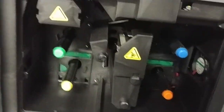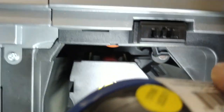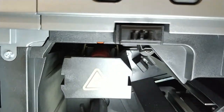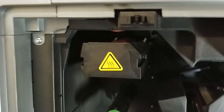Lastly, we're going to open up the printer, remove the ribbon and the film, and then look up inside here. You can see the orange roller up top — that's the card path. The heated roller down lower raises up and transfers the ribbon from the film to the card. We're going to look in this entire area all the way across, looking for any kind of a card through that area. We've now verified that the card path is clear.